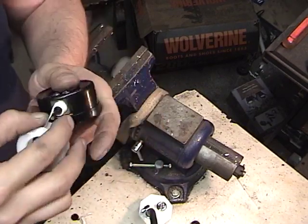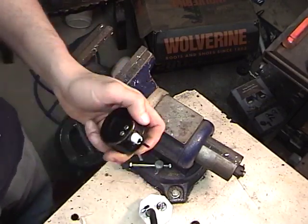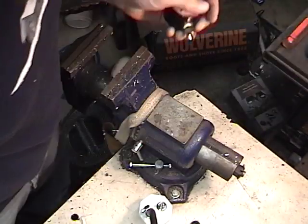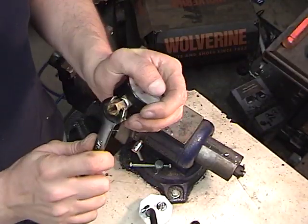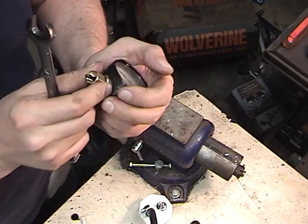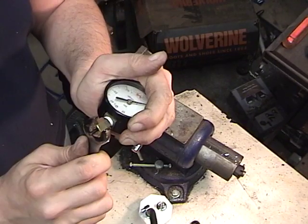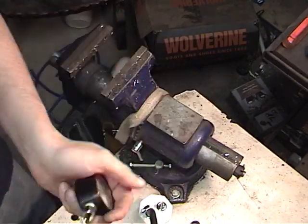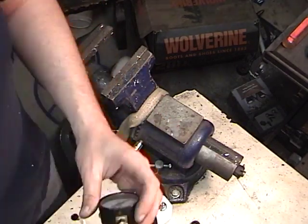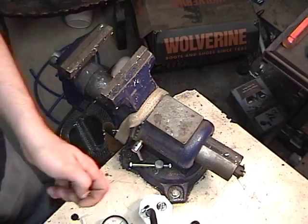I like to give it about four or five winds of Teflon tape on this part because it doesn't have the compression fittings it really should have for this duty. I'm going to take the compression fitting and put it down on here — also looks like a 9/16ths, and it is. Honk it down good and tight, try not to strip it. Now once you've got that on, you attach a quarter-inch fuel line fitting, which also happens to fit right over that pin, which is convenient. Teflon that as well — seven sixteenths. There you have it.